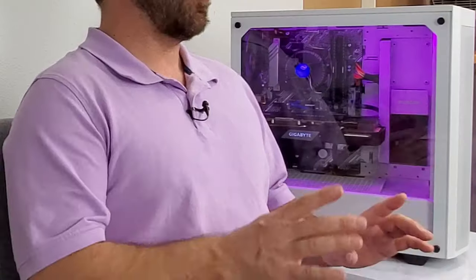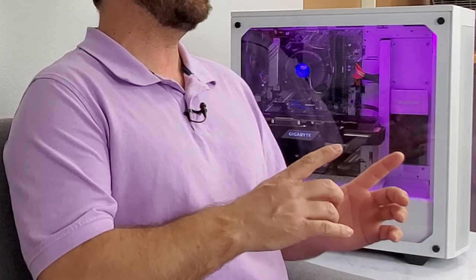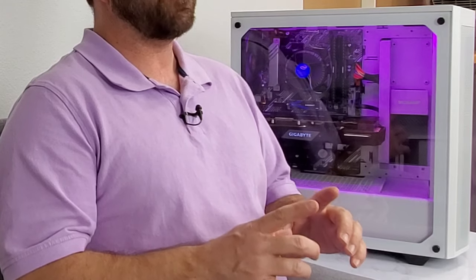As far as the system as a whole, I did run into some stability issues and crashes. First, I did some testing with the RX 5700 flashed with the Gigabyte Gaming OC RX 5700 XT BIOS. However, this led to multiple hard crashes and spontaneous system resets. Now, while messing with a major component's BIOS is usually a user beware situation, I have done this very successfully on both the i3-9100 and the Ryzen 1600 AF systems I've built.